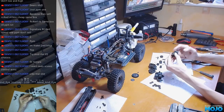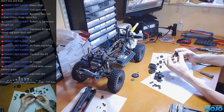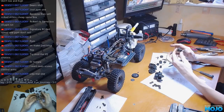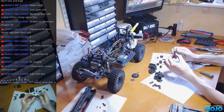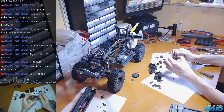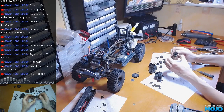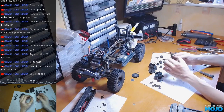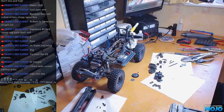Are there any bearings in this? I feel like there is. Yeah, I can see them. Are the bearings in need of changing? If not, I'd rather not bother. That feels pretty much perfect to me. As does that. No wobble, no notchiness. So I think we can get away without taking that little cluster apart, which is all for the better. Just give it a good wipe down and a bit of fresh grease, and that will be good to go. Okay.